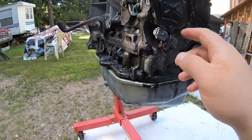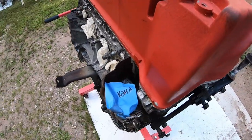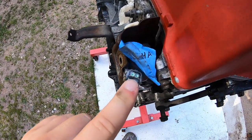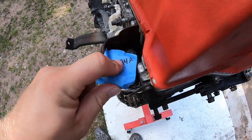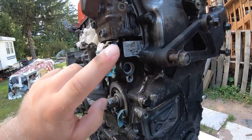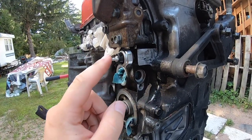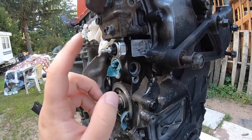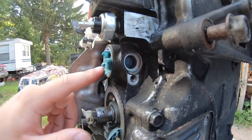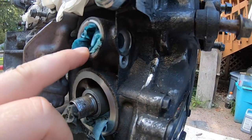Crank sensor — you're going to use your Z3 crank sensor on your K24 swap. Coming into the back here, this is the K24A VTEC solenoid. Looking at this, there is only one plug. The Z3 has two plugs, so just use your Z3 VTEC solenoid spool valve. Coming back here, you have to use the Z3 sensor because the Z3 one has a special connector with a clip on it and the K24 one won't work. You also need to remove the water neck — the little angle neck for the coolant — and the plug off the Z3 and transfer it over to the K24.